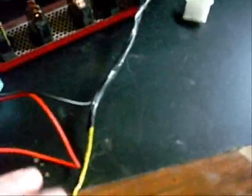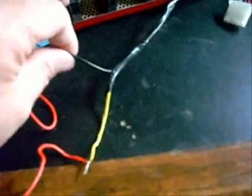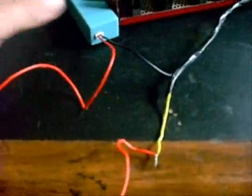Here's our cathode controller, and actually on the wires coming into it, you just have your one yellow 12 volt that runs the power to the cathode as well as the ground for it. So right now we're making a complete circuit. The lights would light just the way it is.